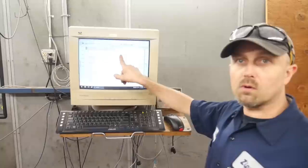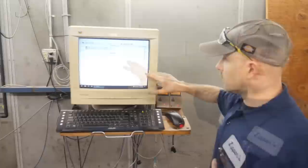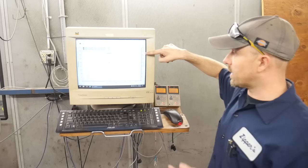So you hit a solid 150 right here at 3750. That's a very good classic true dual curve. We're not making horsepower late. Your peak horsepower is at 5,500. Now, why would we do that? There is more horsepower up here.